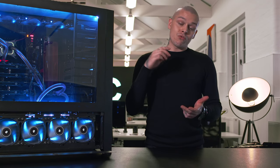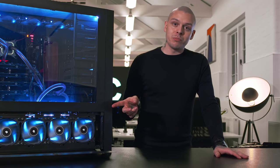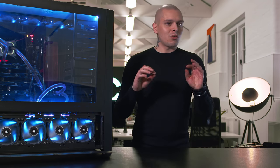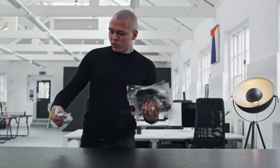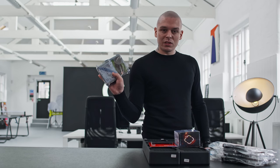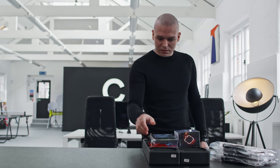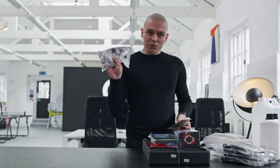Today I'm doing a full maintenance of all my working machines. The render units are simple — all I will do there is update the software. This bad boy needed a full maintenance and a lot of parts needed to be replaced. To start the fun part, let's go to the beginning of the day. New GPU water blocks, new radiators, CPU water block, new bigger SSD, a new 10TB hard drive, water cooling liquid, distilled water, tube, some screws and new fittings.